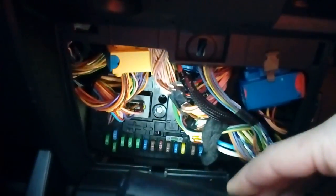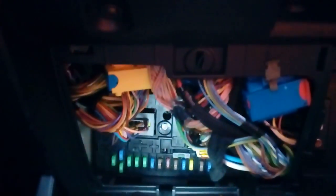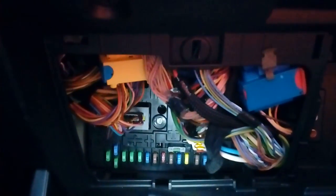On these cars, depending on spec and model, you'd need a multimeter or one of those little screwdrivers with a light in the end to test which fuse goes on and off with the ignition. Generally speaking on these Peugeots, having done loads of these over the years, the normal bet is one of the little brown five amp fuses, which is a good ignition switch. We'll go ahead and test that right now.